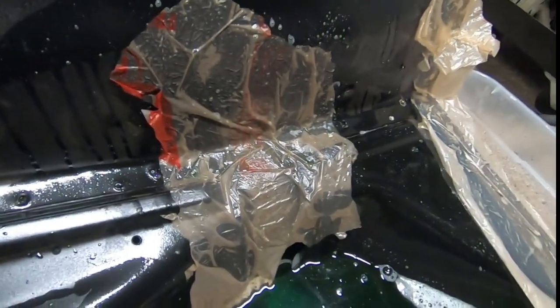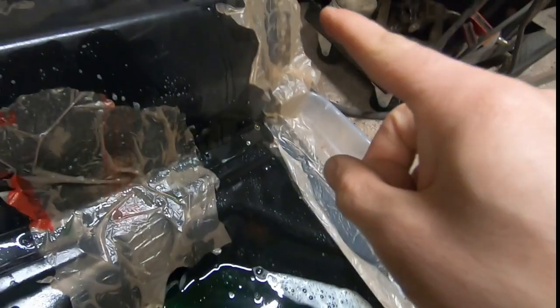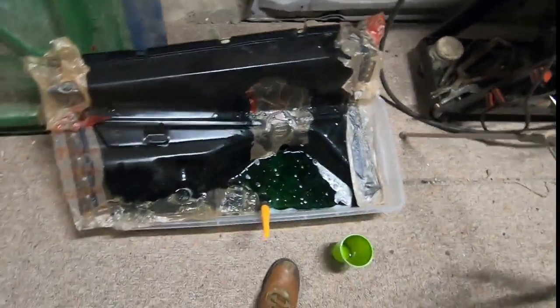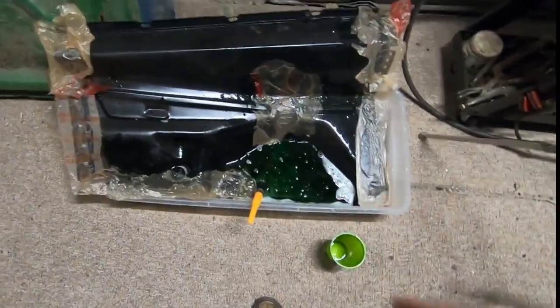If it's out of the pool like this, where there was some rust where the paint couldn't cover, up these edges here where the welds were, same thing over here and all the way down, I just soaked it really good with our brush, those edges, and threw the plastic grocery bags down over it. And then in some cases like this, I just let it go up in there and it soaks and seals it up, and it'll leach in there and hold for the night, and hopefully hold that acid to the metal, to the rust, and chew it right off there like it's been doing there.